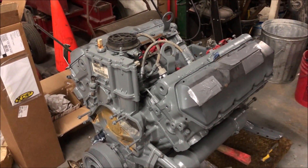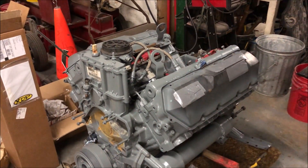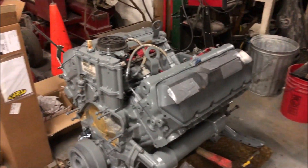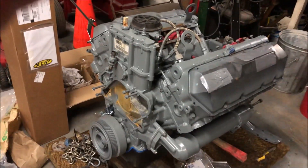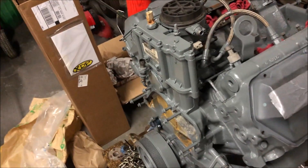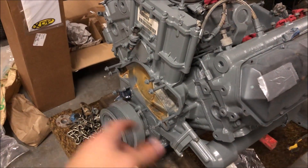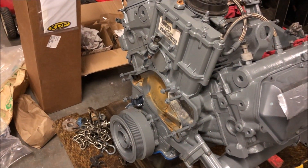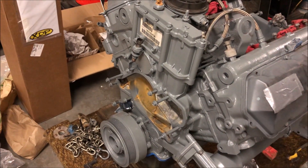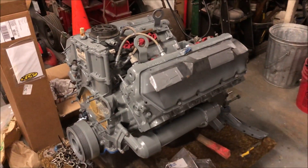The tricky timing part is that I'm going to have to pull my engine out and take the injectors out of the old one while it's out, then put them in this one — and I'm changing the injector O-rings too. I'm also going to swap the water pump from the old engine onto this one, because it's a brand new water pump and I don't want to mess with taking the fan off or any of that. So yeah, it's coming along — stay tuned.